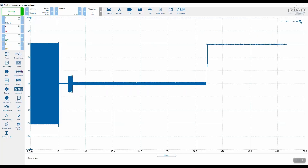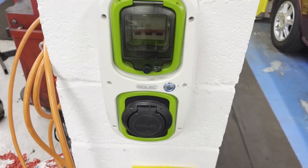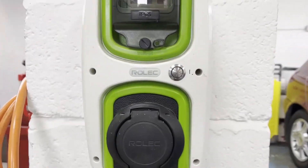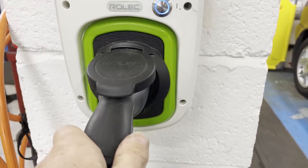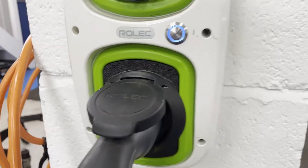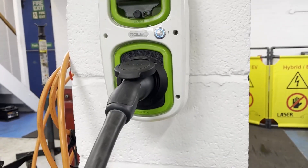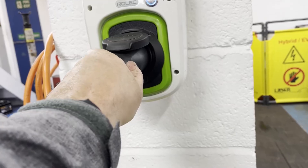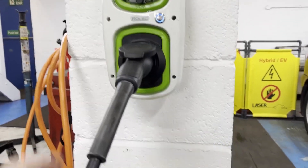At the plug-in mode 3 charger, the blue light is flashing. When we insert the connector it looks seated and the blue LED goes from flashing to fixed — that's because proximity is detected. You'd think at that point it should charge, but as we know, you really have to drive this connector fully home before you get the 12 volts on the CP.